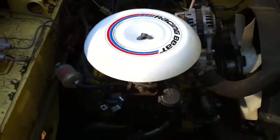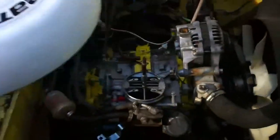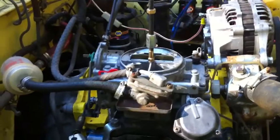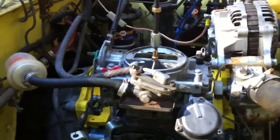We're going to try to explain a little bit of our current improvements in progress. Essentially, today we've decided to throw in the towel on the stock Hitachi 4-barrel carburetor. This is an interesting old beast. I've spent years fiddling with these, as well as the earlier ones on RX-7s that I've had. But I just have not been able to resolve an issue — there's seemingly a lack of primaries, where it'll run wide open if I can get the RPMs up. It'll idle, but otherwise it falls on its face.